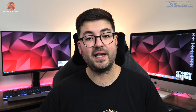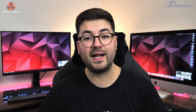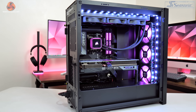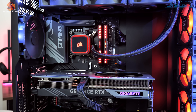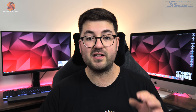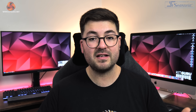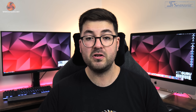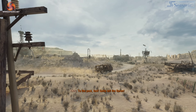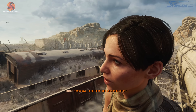Clearly this is a very unique GPU design — I've certainly never seen a graphics card quite like this, so it's time to find out how it performs. For that we are using our regular GPU test system provided to us by PC Specialist, built on Intel's i9-13900KS CPU paired with the Gigabyte Z790 Gaming X AX motherboard, with 32 gigs of Corsair Dominator Platinum RGB DDR5 memory. It is worth noting that I have included all of our previous RTX 4090 comparison data in this video. That data was collected about a year ago and since then we have changed our GPU test system, so the data isn't directly apples-to-apples comparable. However, as we are using the exact same thermal test — a 30-minute loop in Metro Exodus Enhanced Edition — I decided to keep all of our thermal and noise data from the previous tests to provide context.